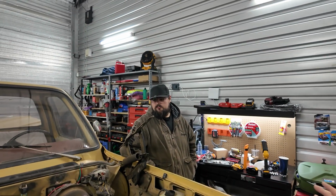We found bearing material, and we found enough glitter in there. I know, but I'm talking about the heads, because we're trying to sell the heads. That oil was fine. Those heads are fine. But if the valves are good, that's really what we're looking for. If the valves are not burnt, they're not damaged, the seats seem decent, we're going to post them on Facebook Marketplace and see how much we could get for them, because the lower part of that block is completely worthless, right?